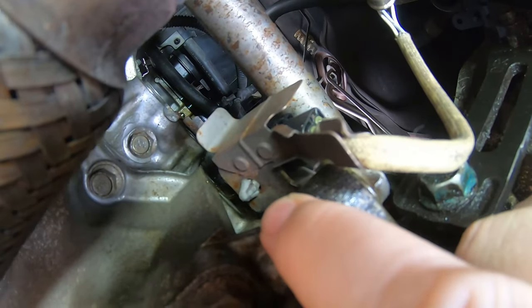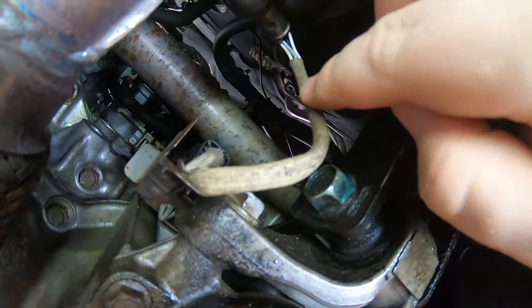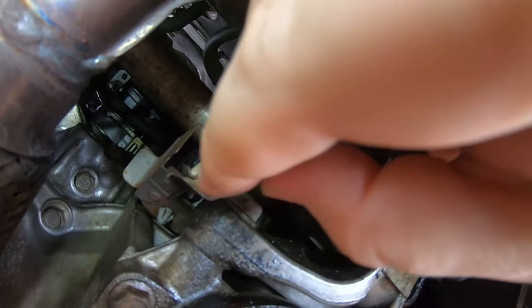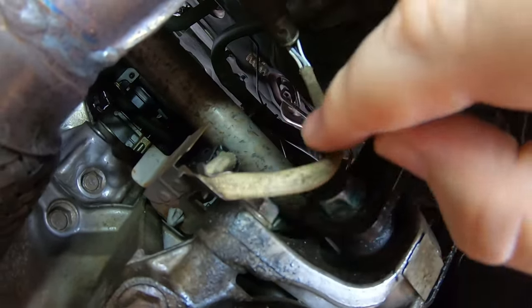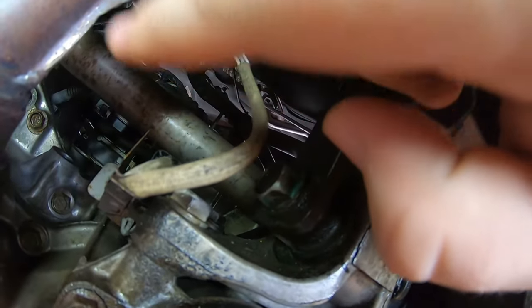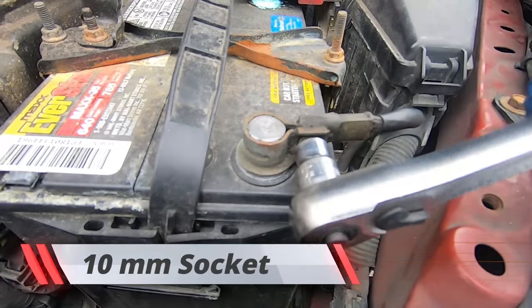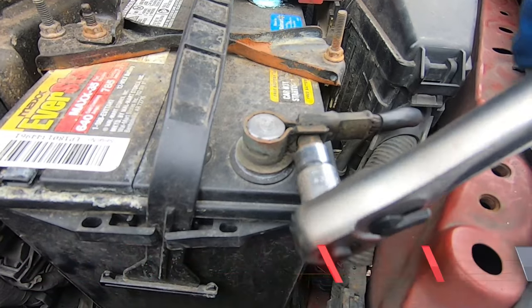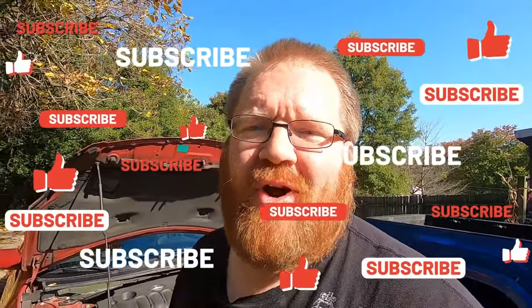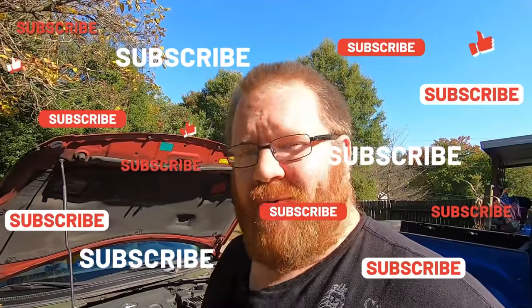Check the plastic fastener — the gray thing right there — make sure that's plugged back in. Then make sure you have your pigtail tucked into the metal bracket so it doesn't get tangled up with the CV joint above or get too close to the exhaust. Last but not least, connect the battery back. That's it for this video — the O2 sensor is back on. If you like our work, hit that like, subscribe, and notification bell for more Trick Shift Garage videos, and we'll see you on the next one.